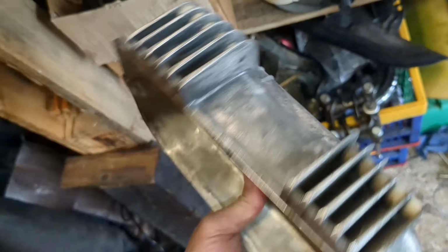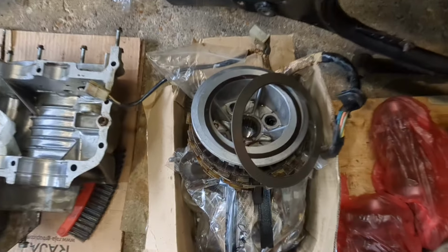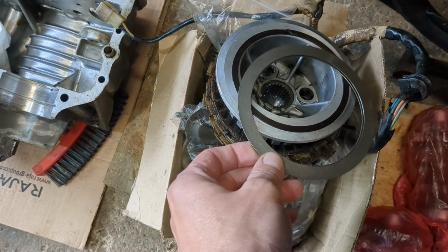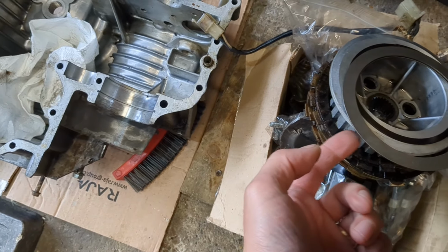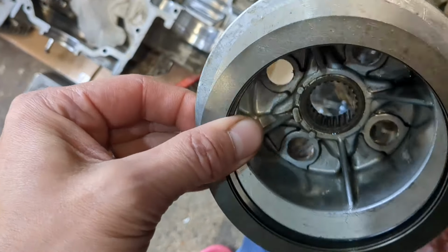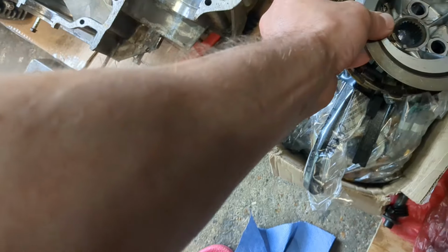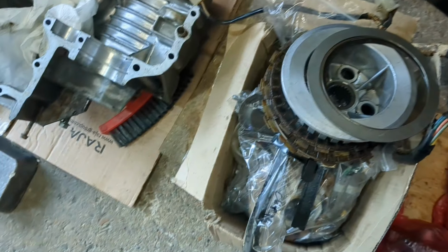It's just the breather cover, the cover for the breather system. I have off camera stripped the clutch all the way down. That's from the basket, because the steel was kind of pinned. I might as well show you actually. There you go, that groove round there. Those two were under that zip, like that. And then that pin was holding in the final steel that was really rusty,